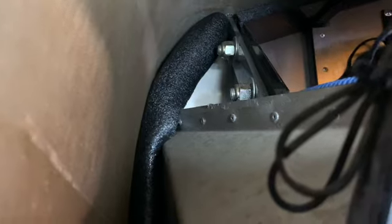All right, and then here's the passenger side. You can see same thing, stuffed back in there and up and over to the windshield post. That's as far over as it'll go. And then you can see faintly I did a half a piece up top there on the other side of the post for a short section where I was seeing a little daylight coming through in the interior. So yeah, that should seal up the passenger side pretty good between the body and the aluminum.